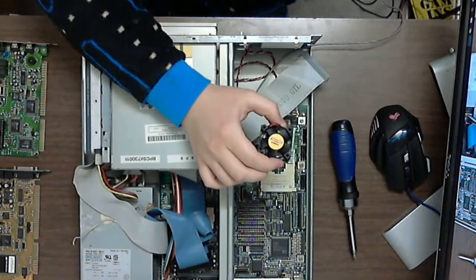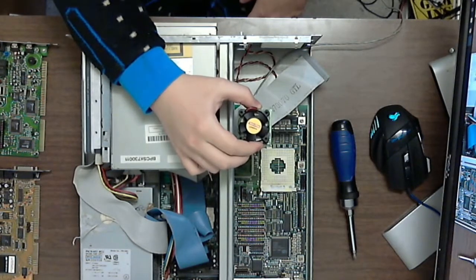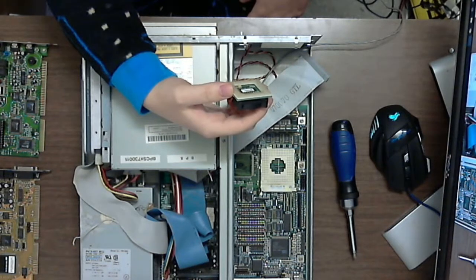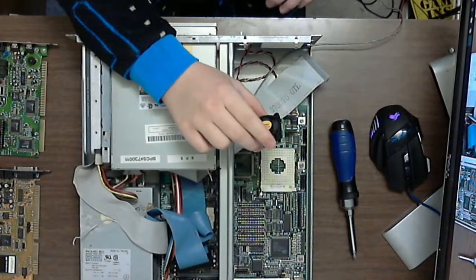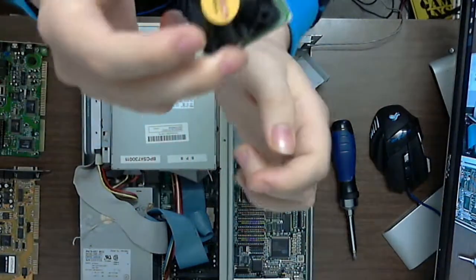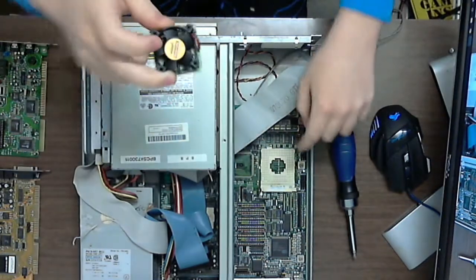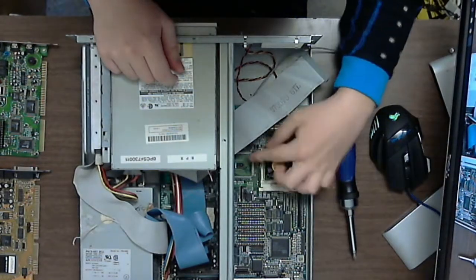Kind of figuring this stuff out through my monitor. This right here is a Kingston TurboChip, 133 megahertz. It's a 486 replacement using the 5x86 — the TC5x86 architecture. This one's the 1545 Revision G. Now, with old socketed zero insertion force processors, you take this corner and line it up with the extra pin. It has more pins than necessary — I don't remember why, but it does.